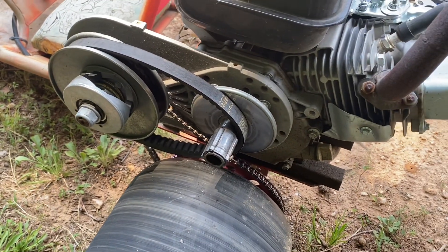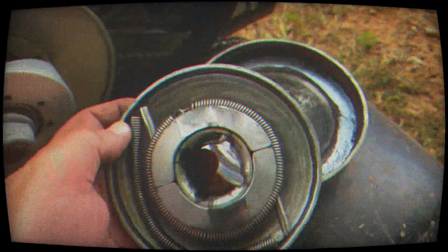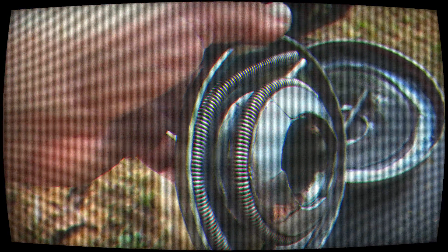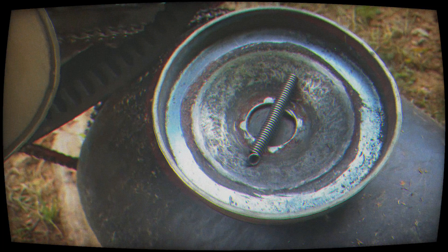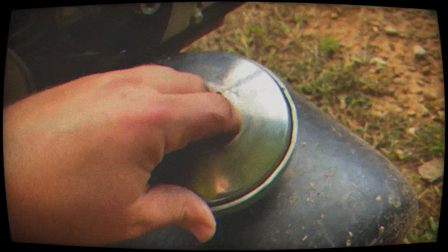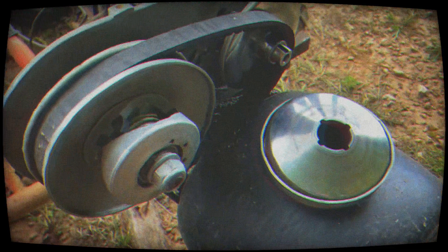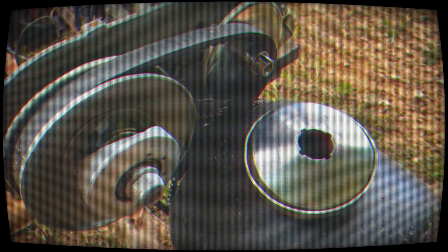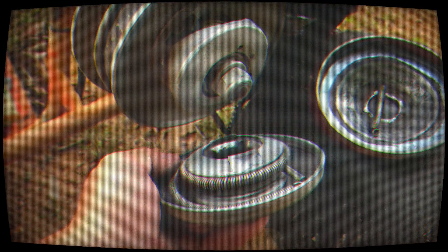I'll add in — the last time the garter spring broke right here, that's what I opened up and found: one of the springs for the weights had broken. So if you have this issue where your torque converter won't disengage, it's pretty simple to diagnose yourself — just take stuff off and start looking for broken parts. It's possible one of your springs could have broken.